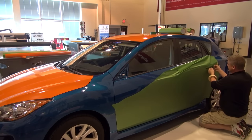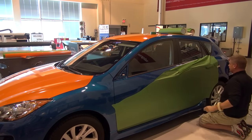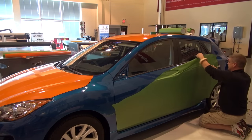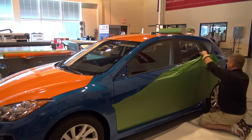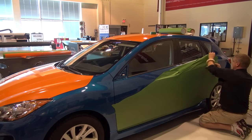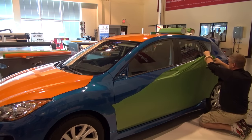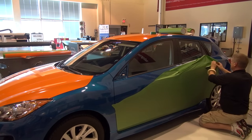That's an open flame, very dangerous, and we have to have what we call a fire watch, proper propane tickets and things like that. So to eliminate that, we really do train a lot of young installers to use heat guns. You know, we can get around a lot of those bylaws simply by using a proper heat gun. Because remember guys, with these new adhesives, we don't need to heat anymore to stretch. We're using heat to relax, and that's really what we want. We want relaxed film that has very little memory in it so that the sun cannot pull that memory back and cause failure.